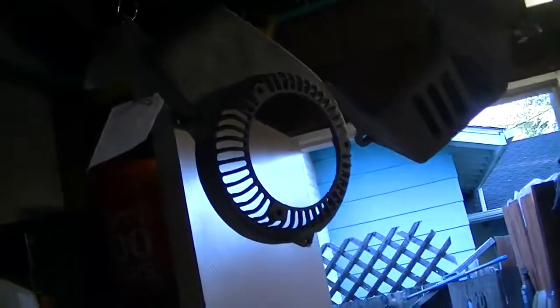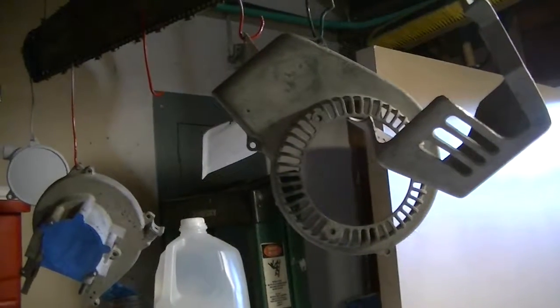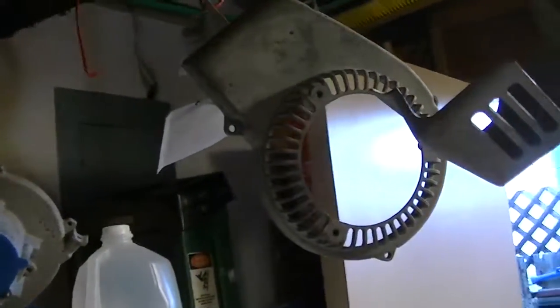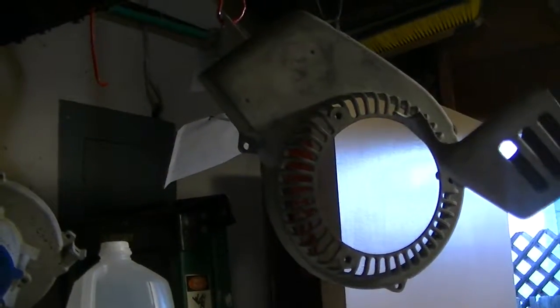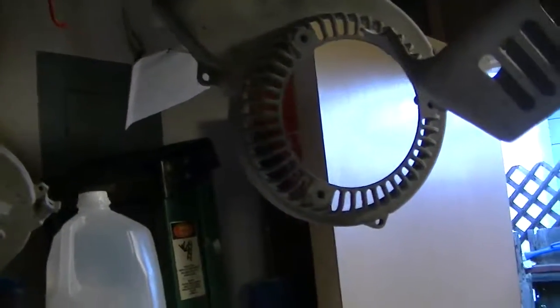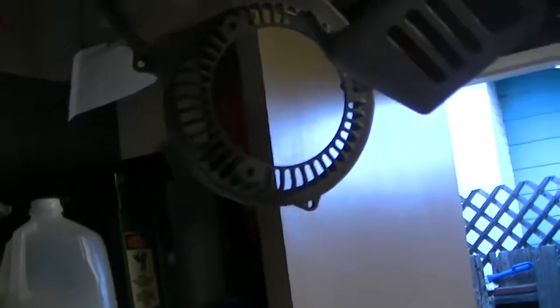So anyway, trying to think of other paint tips I've got. Things like the fan housing and all of those little areas. You can see I've got all these hanging, it's almost easier to paint and prime the backside first, where you can do it hanging, let it dry, and then set it down face up on a piece of cardboard and do it flat.